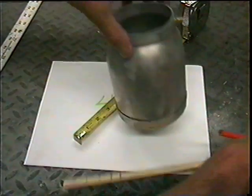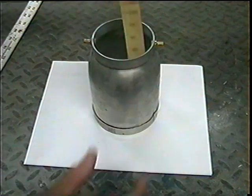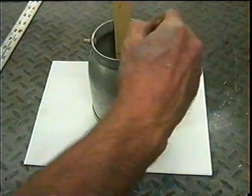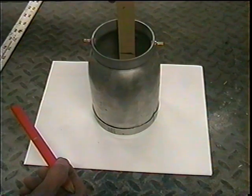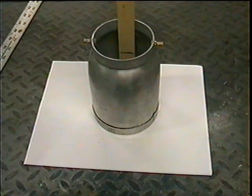Then you can just take your stick after you've made your measuring stick, put it in the cup, fill it up to that line with primer and then the rest with thinner, and you would have your paint or primer mixed perfectly. I hope this helps you out in mixing paint. If you enjoyed the video or enjoy my channel, please subscribe.